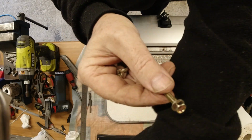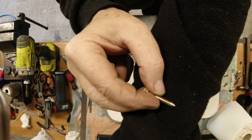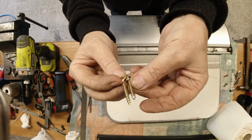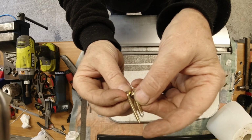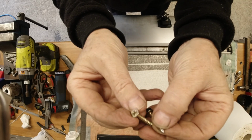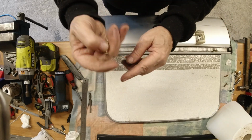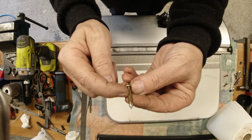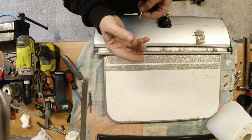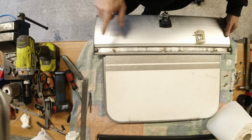Okay, guys, I'm not going to use these. I've decided the body is a little bit too fat. I've cut them and taken them down and pointed them, but I've come across these screws, which are about the same length and don't need cutting as such. I'm hoping the point won't come through the back. More bite and just as strong through the thickness of 1 inch. So I've got 2 of them there, just started off. Again, if I was to make pilot holes for this guy, by the time I pull it all out, I'll have destroyed our little black mastic type of stuff, the Radex. So I think I'll just go with screwing these in.